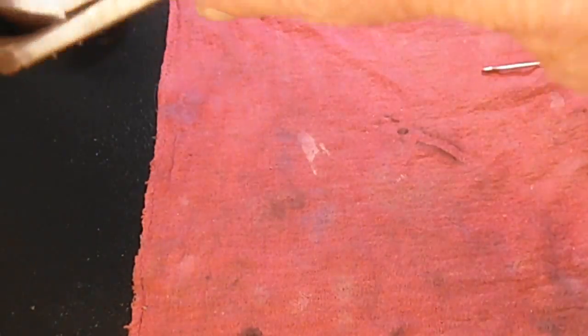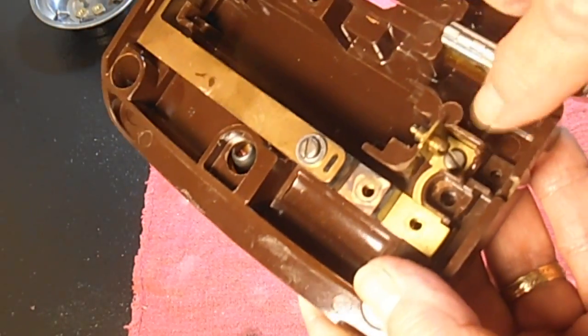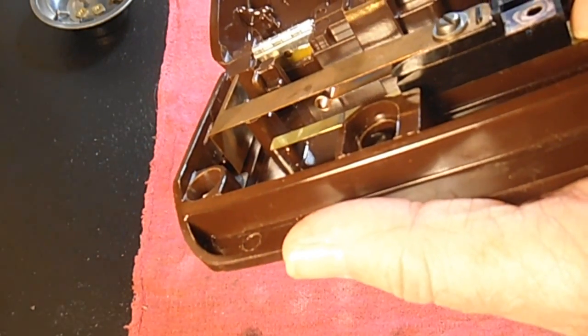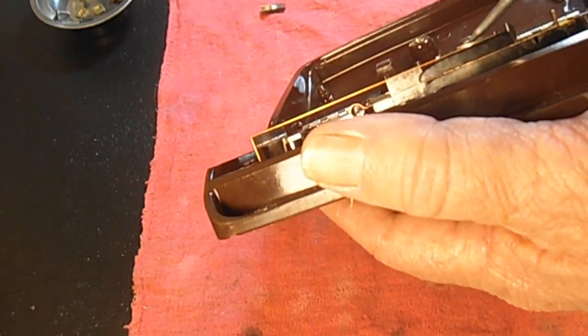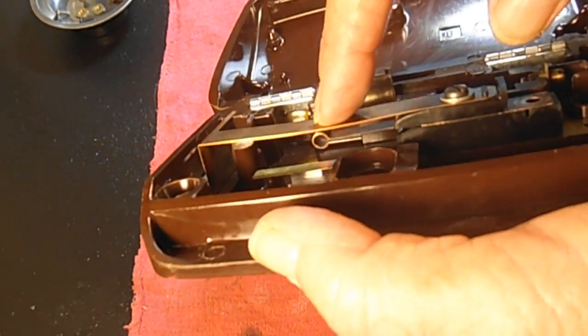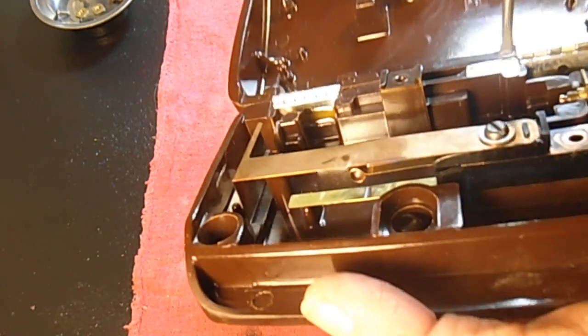Okay, so here's how it kind of looks once we get it assembled. All right, we got the adjusting bracket and screw. There's a brass nut under there. We've got our little spring stack with the shorting spring, the bottom contact spacer, the contact spring in the middle, then the top spacer, and then the actuating spring on the top. And it's all snugged up.